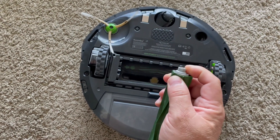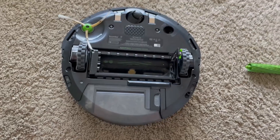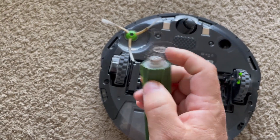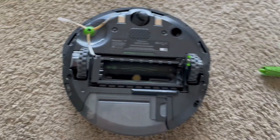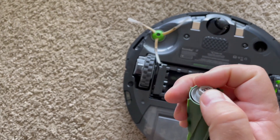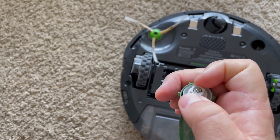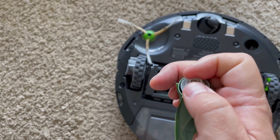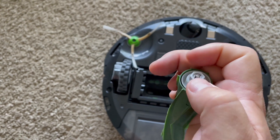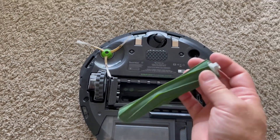This gray part here is not spinning really at all. I've got another set here — this one actually has hair wrapped around it. But once you get that hair off, you can see it spins freely. Unless it's spinning freely like that, you're going to get that error.